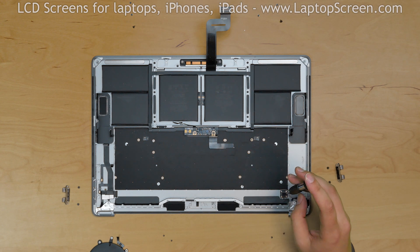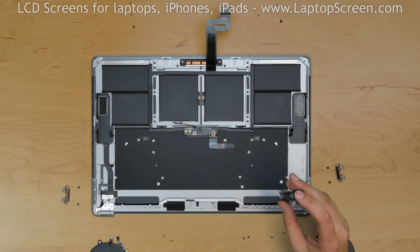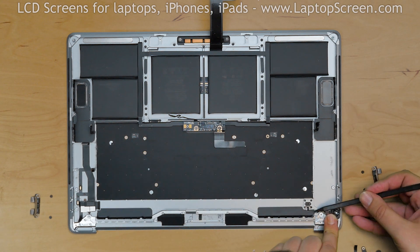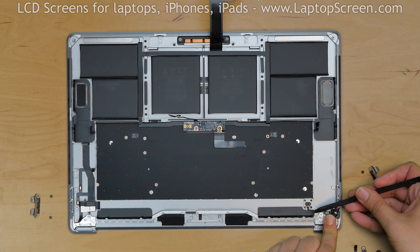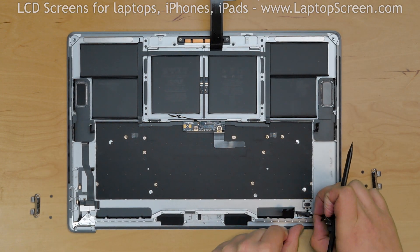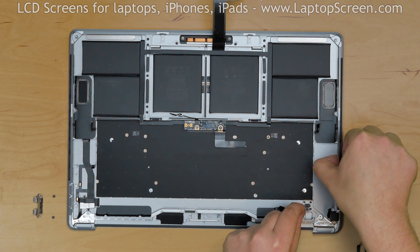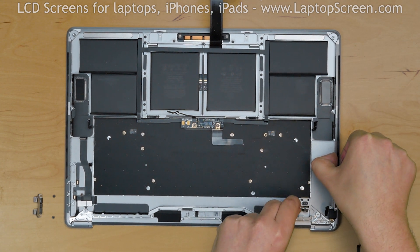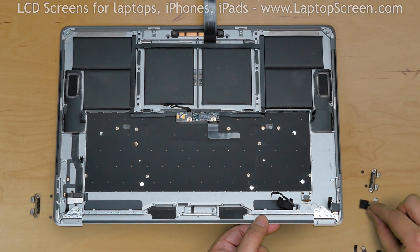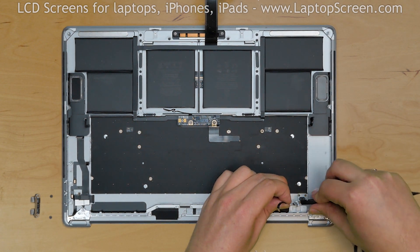The last part that needs to be transferred is the power button and fingerprint sensor. Using a Torx 3 screwdriver, remove 6 screws from the button's back plate and remove the back plate. Peel back the black tape over the power button cable extension, which will need to be transferred onto the new part. Gently unfold the flex cable to the left and carefully unlock the connector counter lever underneath. Pull out the power button connector and thread it through to let the button drop out the bottom. Set the button aside and carefully pry off the power button cable extension.